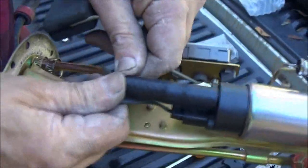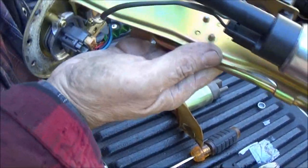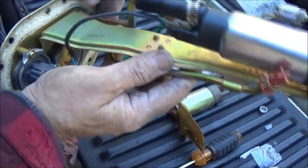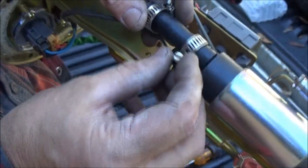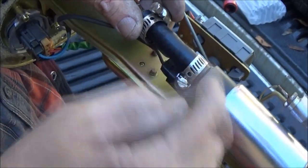See my rubber is a little different, so unfortunately I'm going to have to use the old one. I'll show you the difference — this one's got these tabs and stuff, this one doesn't. So I'm going to have to use the old one in this case, I have no choice. Put that in there and then push your pump back out until it's tight — it's tight up in there, that will not come out. Make sure that's on there. Now you've got your clamps — go ahead and tighten them down. They don't have to be super super tight, but snug them up pretty good.